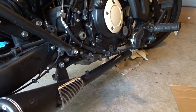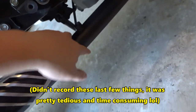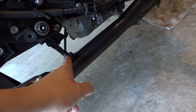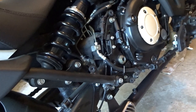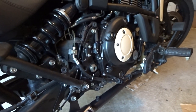All I have to do now is heat wrap the rest of this piping — I'm going to stop right here. Then put on the two springs it comes with, reinstall the O2 sensor, and reinstall this whole assembly right there. Then we'll be ready to turn it on for the first time. Pretty excited.